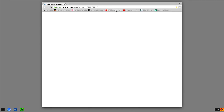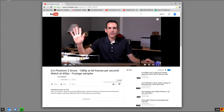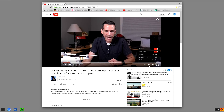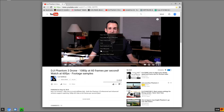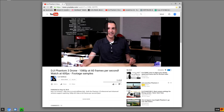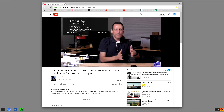Now let's see how YouTube works on this device. These Raspberry Pis are actually very good video players, but with a web browser loaded and all the memory requirements, it's not always perfect. We're getting a little lag, so I turned it down to 480p, and at that resolution I was able to get a passable frame rate. Now that the page is fully rendered it's working better — 480p is about the best you'll get before you see major lag. Looking at the stats for nerds, it drops a frame or two here and there at 480p, but you do get video with sound through HDMI. Because you only have a gigabyte of RAM, you'll want to keep just this open for decent performance.